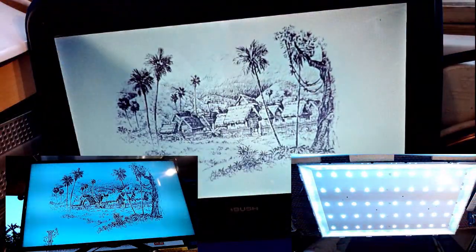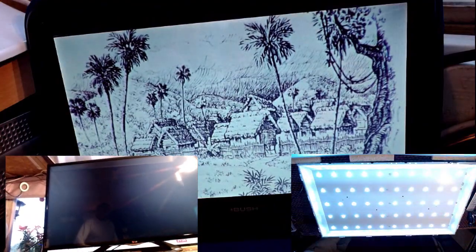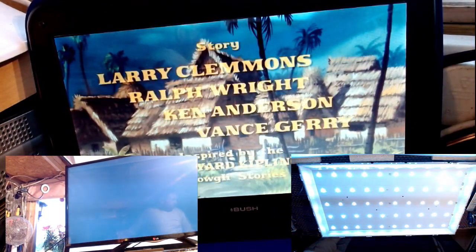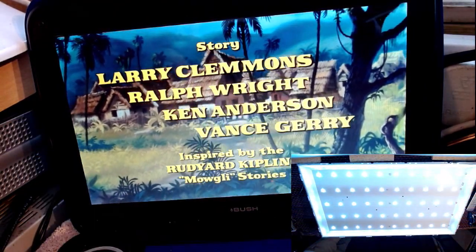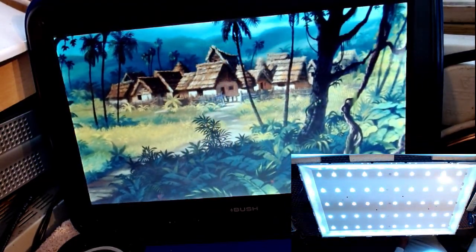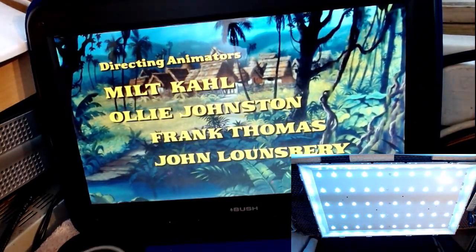I'm not trying to save you money on the electricity bill here, even though it probably will over the years. But it's saving the life of these backlights. These TVs are 6 years old, and the backlights have only just failed. Some standard TVs will disappear and fail, backlights-wise, after just a couple of years. So for these to have lasted 6 years, almost 7 years actually, one's from April 2013. Oh yeah, that's over 7 years.